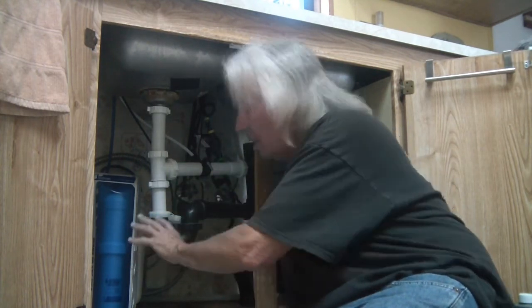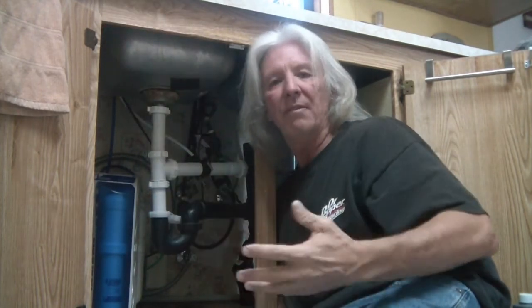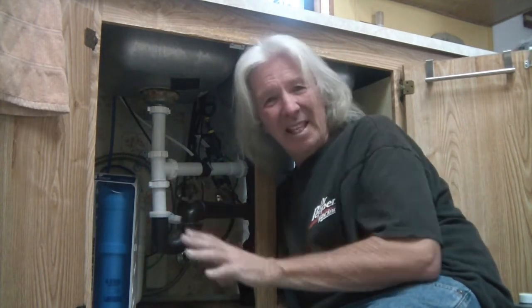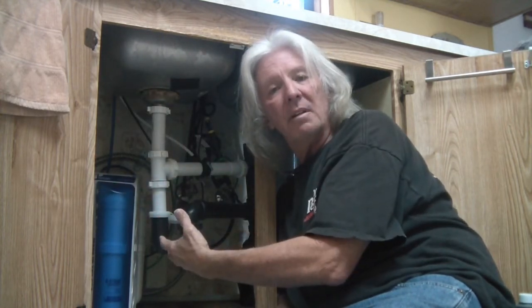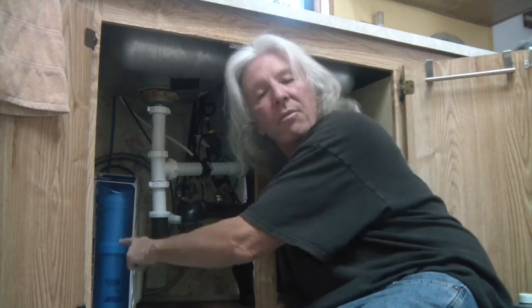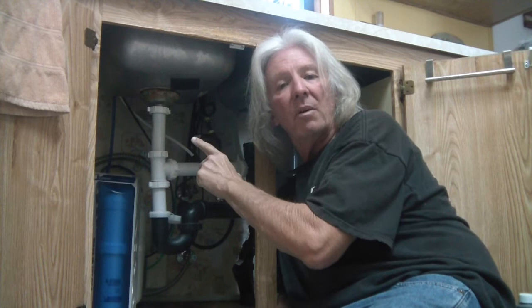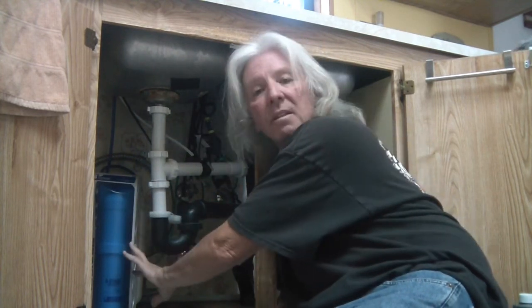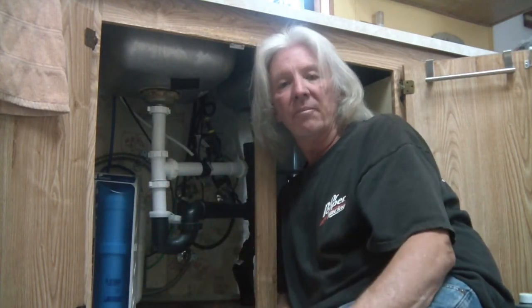If your filter still tastes fine, take the water from your reservoir or bladder, fill up a couple containers, and put them in the refrigerator so you have cold water for a while. Since mine has a funny taste, I'm going to drain it and let the new water fill back up in the bladder, then drain it again. You always want to run water through the new filter to flush it out — go up top, turn the water on until it starts dripping out, drain it all, let it refill, then do it again.